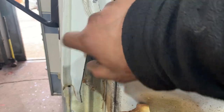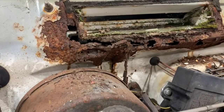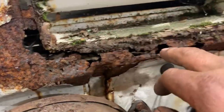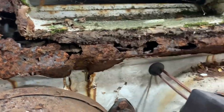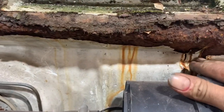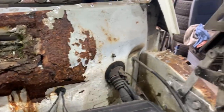So I've drilled all the spot welds, and as you've just seen, they didn't really have to do much around the vent panels — give it a good tug. I've cut it in the corners for the minute, away from where I need to join it in here, just purely to allow me this bit easier. But there we go — look at that. That's going to be fun. So basically I think these pretty much have it. We have what could be described as a fairly rusty bulkhead.